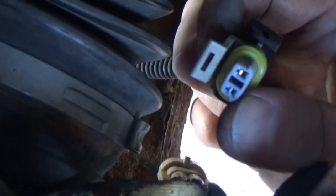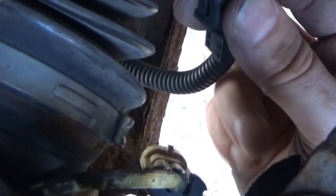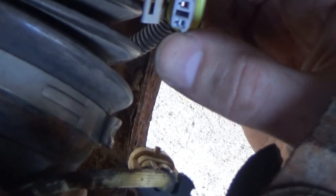On the other half, this is the body end right here. That connector looks clean. Well, no, I take that back. There looks like there might be a little corrosion there, and is that the same terminal that's broken? Maybe not. It's really not too bad though, but yeah, maybe a little bit in there. But this thing right here, that's gonna answer that question. Well, I guess that pin is pretty cruddy in there. But yeah, that's no good. Now where's the wire? There it is.